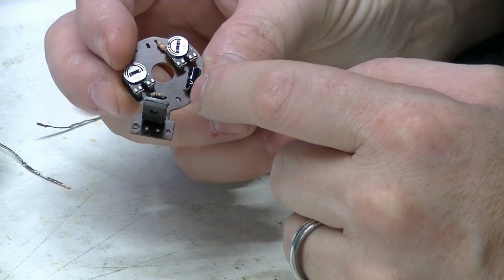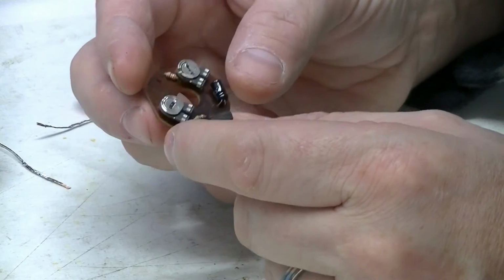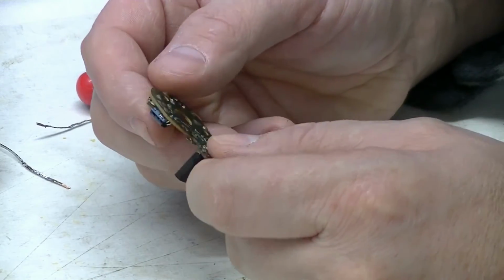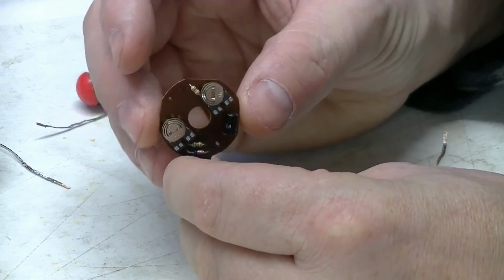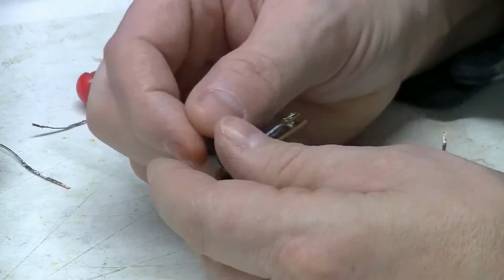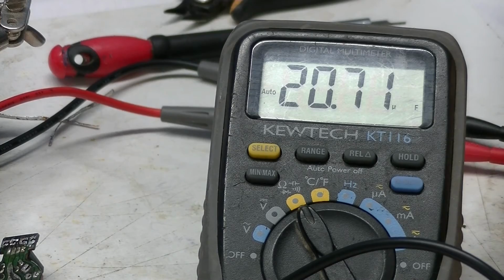make sure that it's okay, check the diode, and then what we'll do is we'll put it back together and see if we get the right speed. We can try adjusting these pots. We still got a bit of movement there to adjust them, so that might do it, but chances are this component here might be faulty. It should be 22. 20. That'll do. Fine by me.